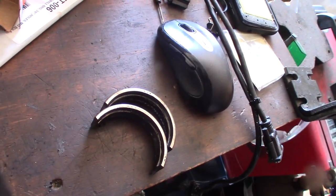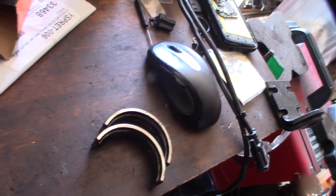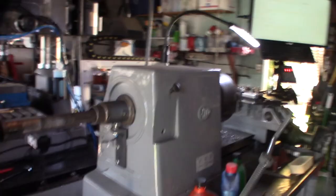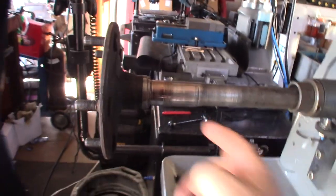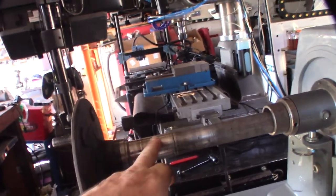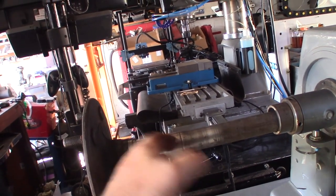The only issue with that one was it wasn't sealing — the surface area where the seal sat had a pit in it, so it wouldn't actually create a seal. I could have sleeved it. I have this thing in the back of my lathe — I was gonna turn it but I couldn't fit it all the way through. I went back and just polished the surfaces where the seals go. That's usually where it fails — see that little divot right there? Once that thing gets worn out, it can no longer hold the seal. You can actually sleeve these things, but that's actually why I had to replace the other axle — it was all pitted up and thrashed.